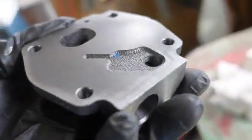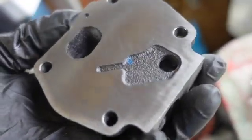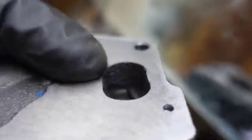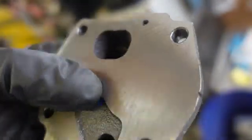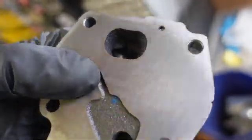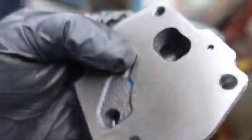Well, the other thing you run into, not only do the gears not ride correctly, it leaks. It'll leak. So I can see why people blueprint these. You know, that passage there is kind of nasty. See all those dimples in there? Maybe that's what they're talking about. I don't know. What do you want to do there? There's some pretty nasty casting mess there.